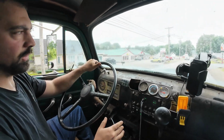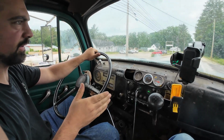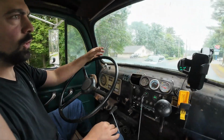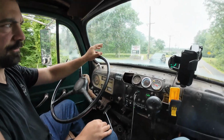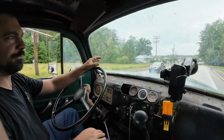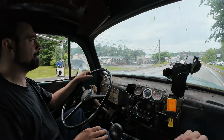But unlike a normal diesel, that's like at governor. This thing's governed at I think 3,000 RPM, and the max power and torque is at like 28. Gotcha. It's an old school turbo too, where it's not very efficient, and it really only creates boost right at the very top. Right. So if you go get a better turbo and you modify the governor to actually send fuel at the right time, you can widen that power band out a lot.